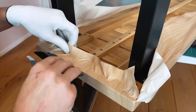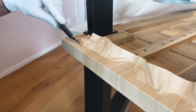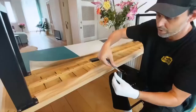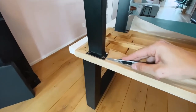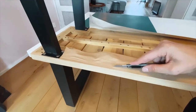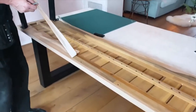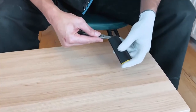For the middle section, heat the film to relax it, squeegee it roughly two centimeters past that point, then cut it one centimeter from the edge. Remove the excess film carefully — and always click your blade to keep it extra sharp. Keep the angle of the blade low and flat to the surface, and make sure the cut is nice and symmetrical for a professional finish.